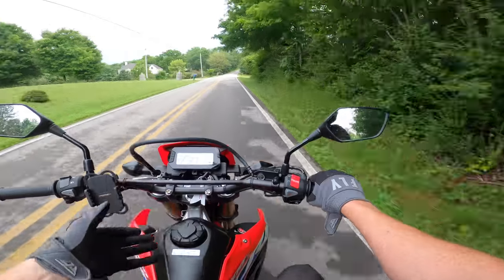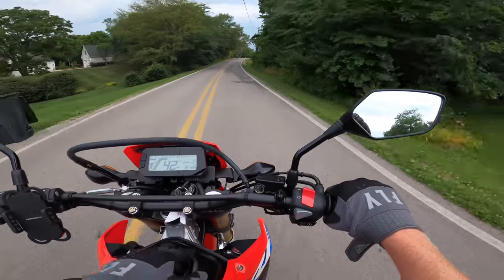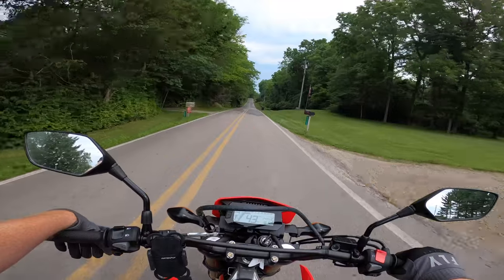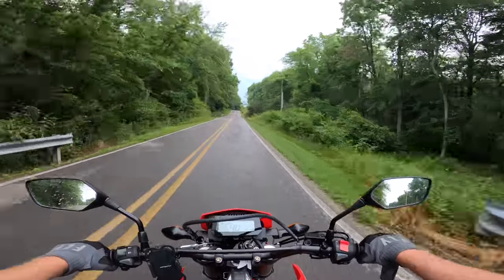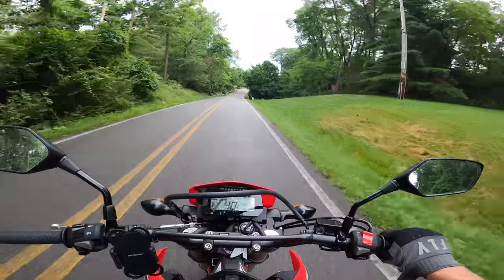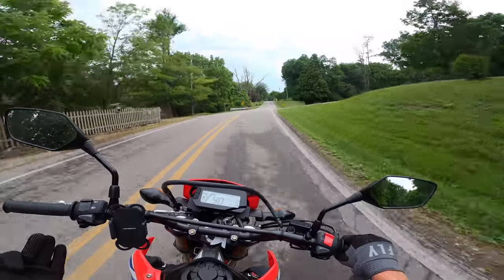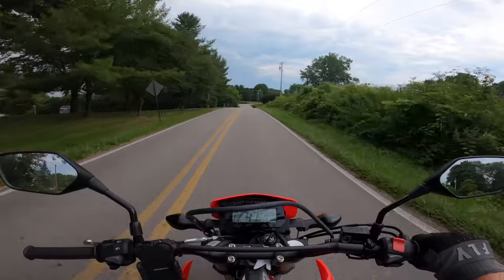There's definitely less vibration — everything about this setup is just smooth. And here's the thing: it doesn't take a lot of effort to do once you've done it once and have all the kinks figured out. You've got to trim the front fork guards — shout out to Daddy Long Neck who had a set from his 250L. If you don't do that the tires will rub bad. You also have to watch your front brake line because that'll rub too, so you've got to relocate it. Since I have the factory 40-tooth sprocket in the rear, I don't have to adjust the chain. I literally think I could do this swap in about 10 minutes now that I have that 14mm Allen for the front axle.